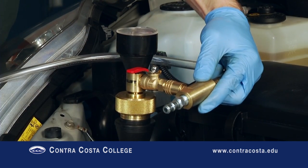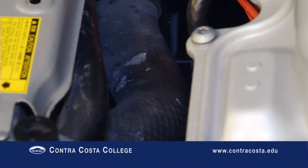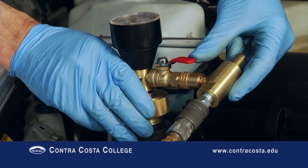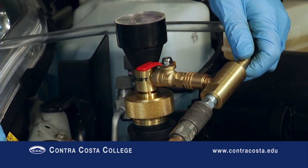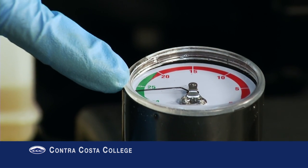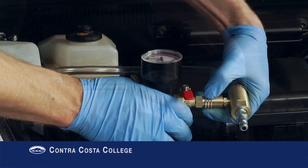Connect an airline to the airlift and open the valve. Draw all the air out of the cooling system — the hoses may collapse and become flat. Turn off the valve once the vacuum indicator stops moving. If a cooling system leak were present, the vacuum gauge would fall steadily once the valve is closed and the air source is removed. Check that the vacuum indicator stays the same for several seconds after the valve is closed and the air source is removed.